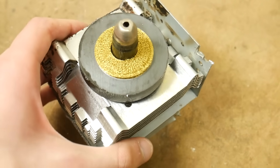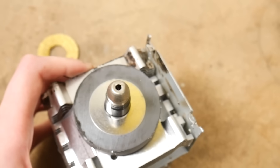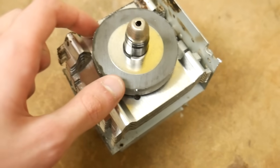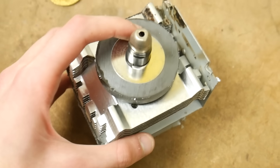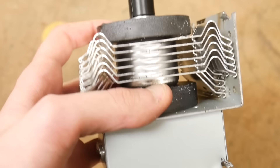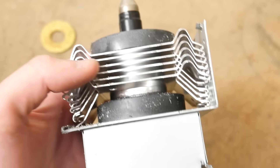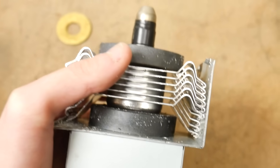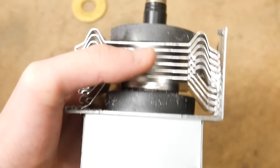It's a little while later and I've made some progress. I've removed some of the outer case of the magnetron. This piece that just fell off is just a brass reflector — it prevents waves from bouncing back into the magnetron; that's not really important. Here beneath the antenna and beneath the cover, we can take a look at one of these permanent magnets. There are two of them, once again to make a magnetic field going through the cavity of the magnetron, which you can see in there is the cylinder. Surrounding it are the heat sinks, because this magnetron, while it's in operation, gets very, very hot. If you look inside of a microwave oven, this is what the fan is pointing at.